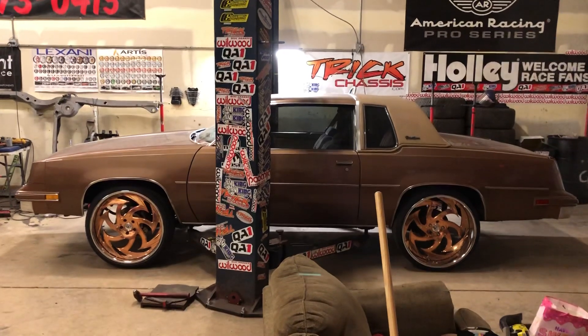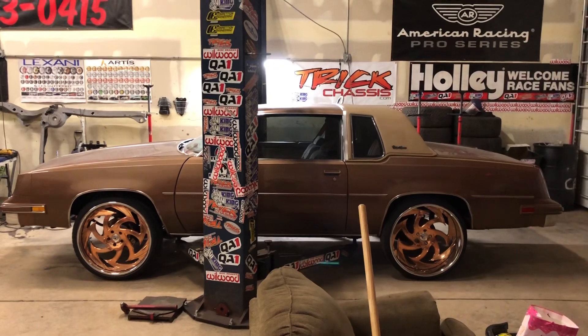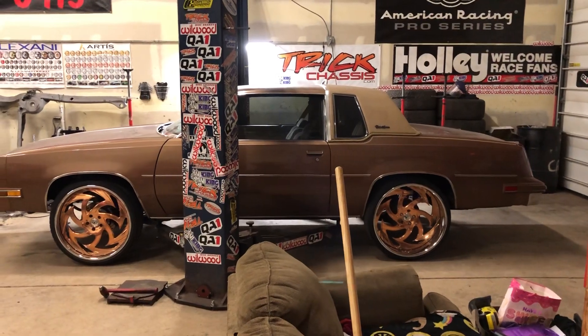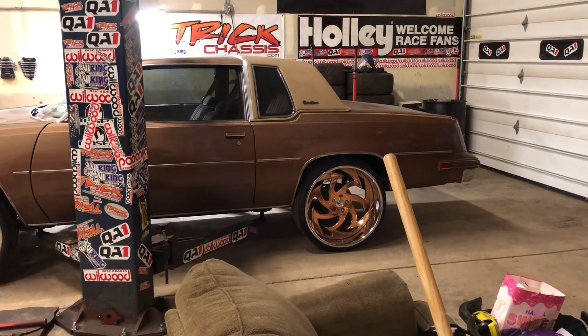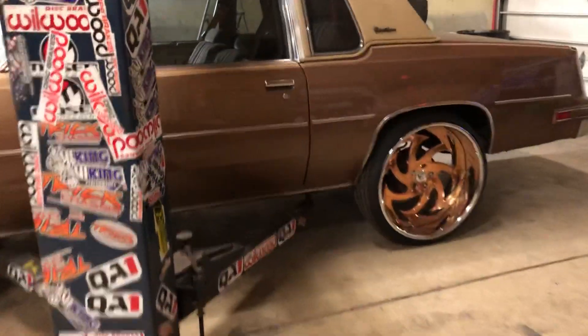Getting Kevin's Cutlass back up on the lift — Quinn's Tires, Aurora, Illinois. Getting his back up on there so I can finish the back of it. The back of the car has never been touched. It has bolted wheels on it, but it's getting narrowed. Quarter rail notch, adjustable buckets, tubular control arms — everything sitting over here on the table.